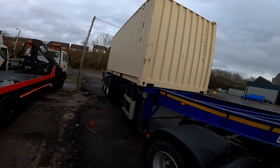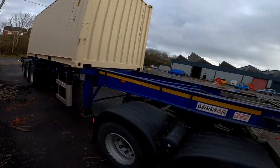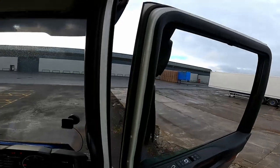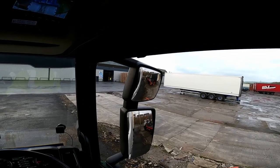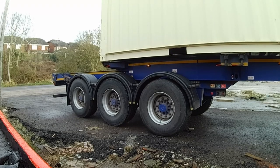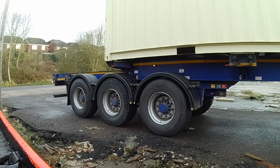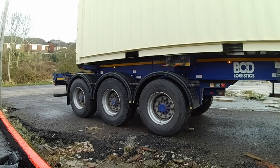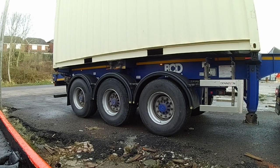The trailer is locked — it's in the parking position and locked. We're going to reverse the unit so the whole thing slides back. Select reverse, release the handbrake. If it doesn't budge, do a couple of pulls — back and forward, back and forward. There we go — it started to move. The pins are in, they are unlocked, and the box will just slide towards the back. Go until you hit the end, that's it.